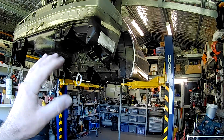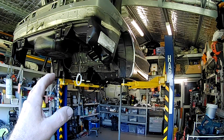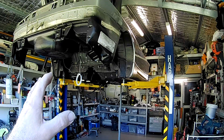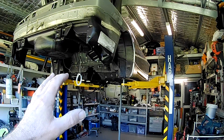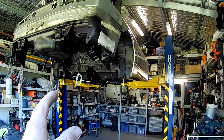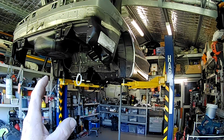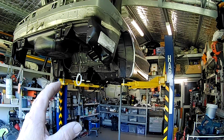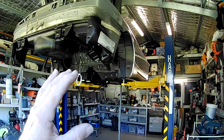Those are the only bolts I've replated, plus brackets and things like that. Very high tensile fasteners are easily identifiable in areas of the rear axle assembly — the factory finish wasn't electroplated, they were just coated, so they've been put to one side and will be recoated. Any damaged bolts have been replaced with new ones ordered from Nissan. I know from watching other people's electroplating videos there are always lots of comments about hydrogen embrittlement, which is fair enough, but if you understand the process and the relationship between the bolts used and corrosion protection, you give yourself a chance of being on the money with what you're doing.